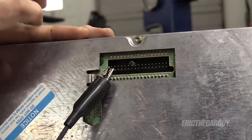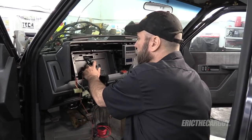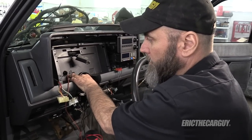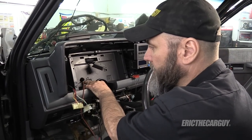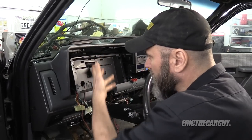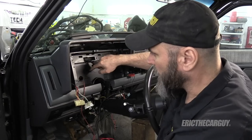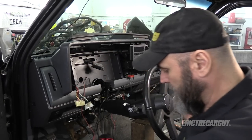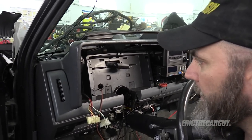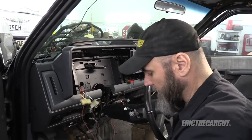We've done just about all we can do here inside the instrument cluster. The rest we're going to have to do off the harness side inside the truck. This is the connector inside the truck, and this is where I'm going to pull the wires out from. This is where I'm going to run the wires for my new gauges — like my cooling temp, oil pressure, and all that stuff — and then through my hole in the firewall. So everything is basically going to collect up in this area. I only need to pull a few wires out of this harness, and I'll pigtail these wires off and connect them to the gauges when the time comes. I also thought about plugging in the headlight switch so we can verify what we've got going on here.